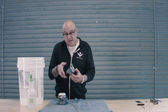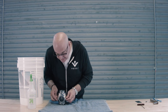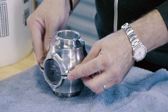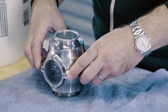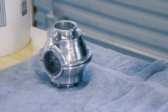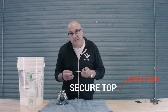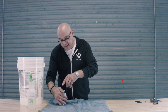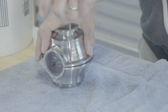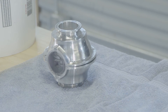Now we turn that upside down and go in here to reassemble. There will be a space between the two halves — that's normal at this point and will disappear as we tighten the screws. We go back to the four screws and drive them the opposite of what we did in disassembly: two screws on this side, then turn it over and drive the other two screws on the other side.